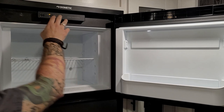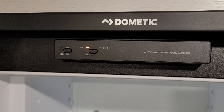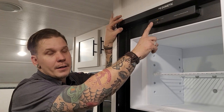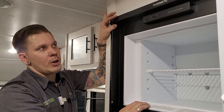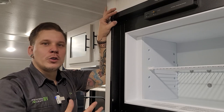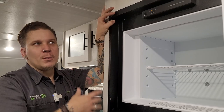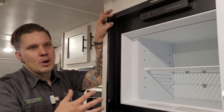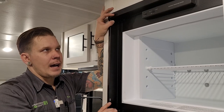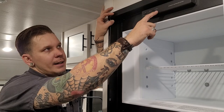Up top here, we have your Dometic refrigerator. Opening up the freezer door exposes the eyebrow panel. This is a two-way refrigerator, running on 110-volt electricity as well as propane gas. The first button is the on/off button, and the next button is how we turn it on to gas. It defaults to auto — if AC voltage is available, it uses that. If that voltage becomes interrupted or you're going down the road, it automatically switches over to gas. If you want to run it specifically on gas, depress that switch and it will start lighting on gas. If it has any problems lighting on gas, it will illuminate the check light.